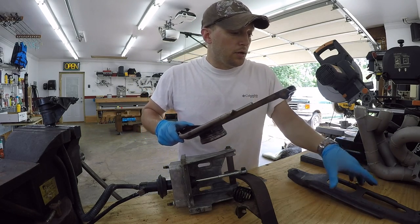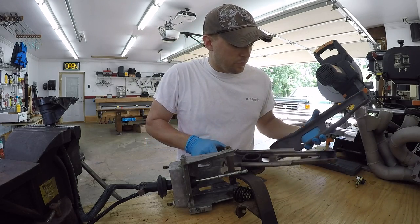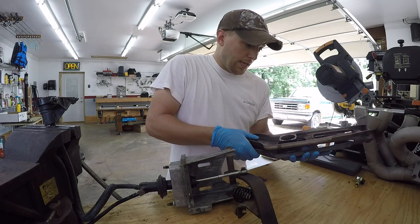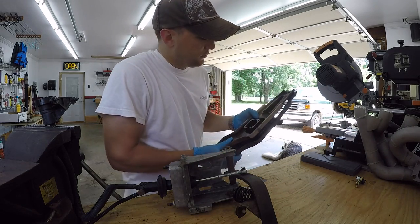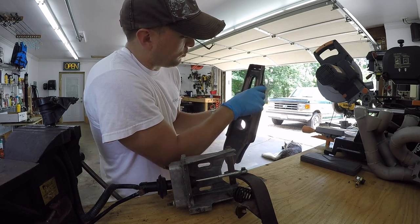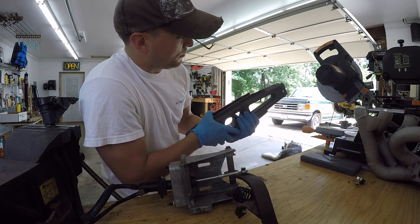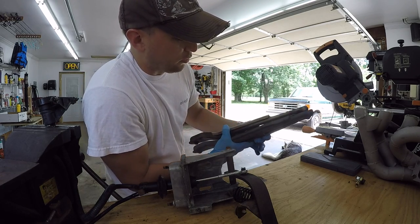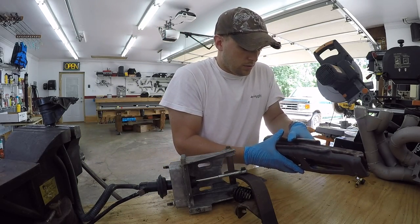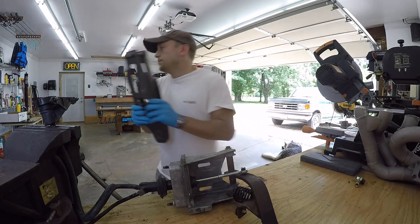So I went ahead and bought one of these. It's not an OEM one, but it's the upgraded style. I got it off Amazon for relatively inexpensive. Lining them up here, you can see the difference: they're reinforced longer on both sides, right where they were known to crack. The gauge is steel and everything looks the same, but they're just reinforced longer. So, knowing that this is not the issue, it was time to move on to the clutch pedal.